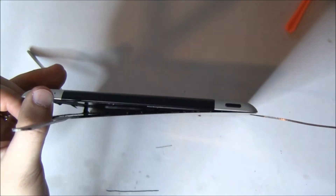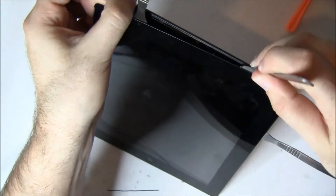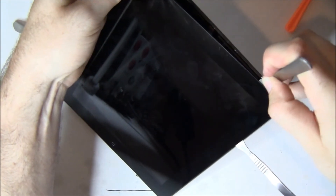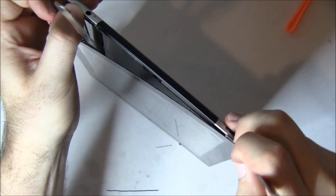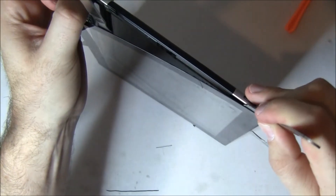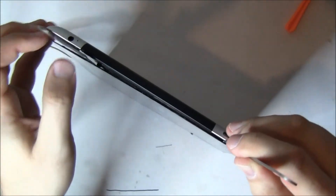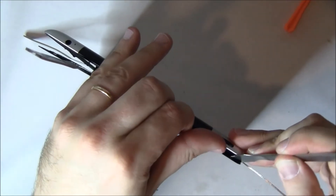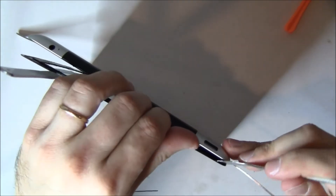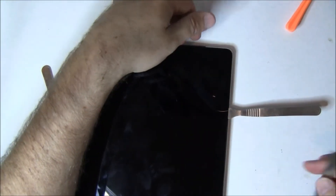The antenna wants to just lift right out and we just keep it in its little hole. Now we've separated three of the sides — we're down to the last important bit. He's only got that spudger in about a quarter of an inch right now to make sure we don't damage any of the cabling. See how he's lifting it up and getting his fingernails underneath it. The two flex cables in the upper right — the ones you don't want to cut — aren't actually adhered to the screen. It's just that if you slide the spudger in, you'll cut them. So in this area, just use a bunch of heat and lift the screen off.